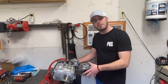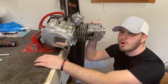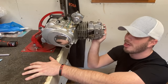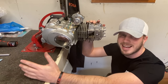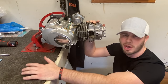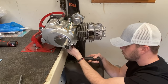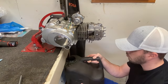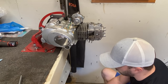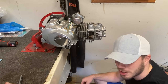So the diagnostics are over. We have determined that we've got low compression and we have an intake valve issue — nothing left to do besides break it down. I'm going to go ahead and drain the oil out. You don't necessarily have to do that as part of this process — you could just tilt the motor up a little bit. But if you're having motor problems already, it's probably not bad practice to just go ahead and change the oil anyway. And if that oil looks fairly new to you, that's because it is — I just changed the oil as part of the process of rebuilding this ATV, and then I checked compression and found out that I have the issue.